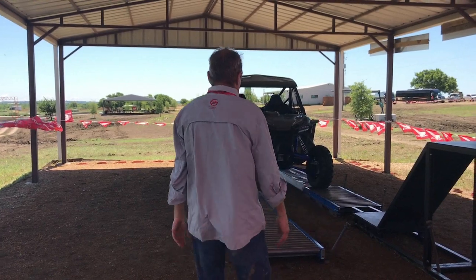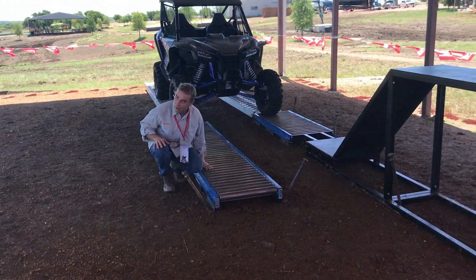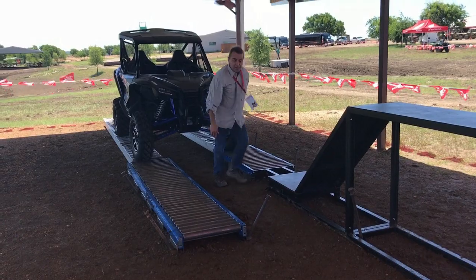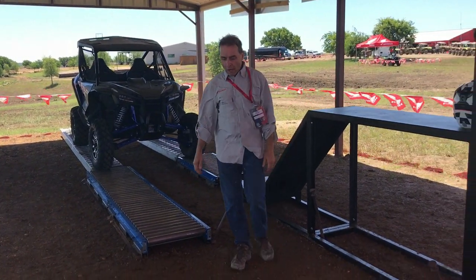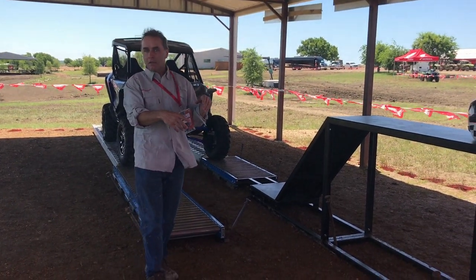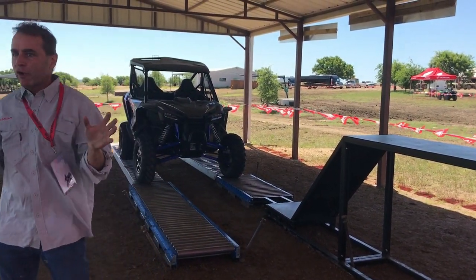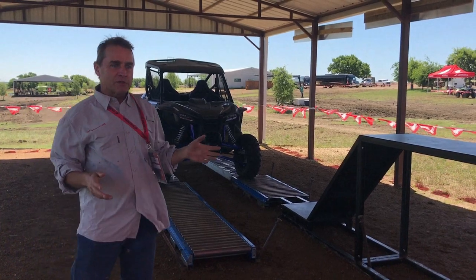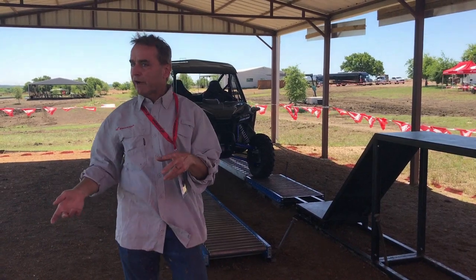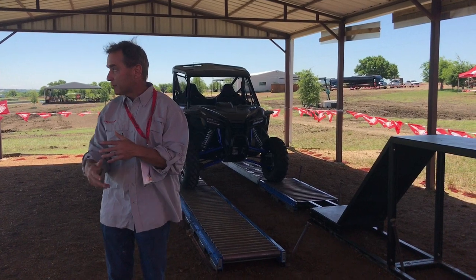We've got two sets of conveyor rollers on bearings. None of them are welded shut. There's no traction. I'm going to get one wheel crawling up here and another wheel is going to come up in the air. There's no traction in the air either. So we're going to have three wheels just grasping for nothing. When those wheels are grasping for nothing, our automotive sensor technology is going to sense that and send all that torque to any wheel that's got the traction.